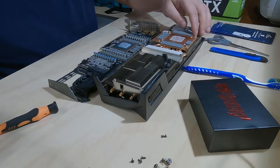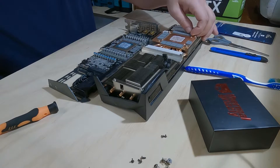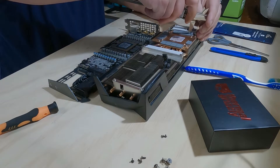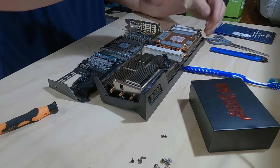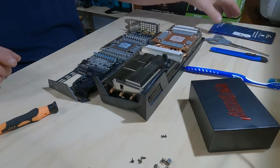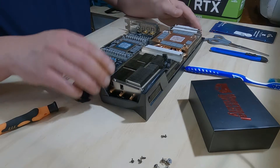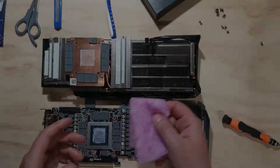The first thing I want to do is check the thickness of this thermal pad. I do have 2mm thermal pads here — I didn't look it up, I just kind of went with it. Hoping we have the right thickness. That is 2mm, so if you own a Gigabyte RTX 3090, you need your 2mm pads. I'm going to speed through the next part — clean the card up, get it ready so we can put the new pads on and do the thermal paste.